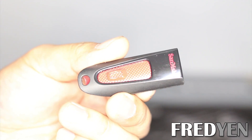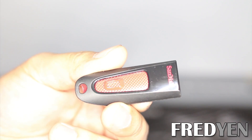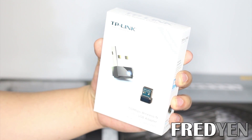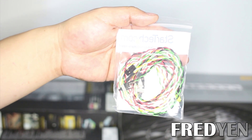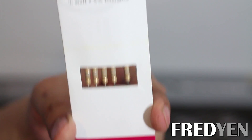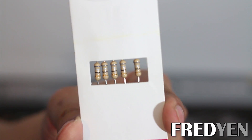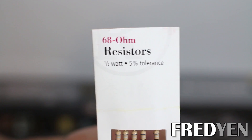Depending on what operating system you choose — whether you go with Windows or Linux — you'll need some type of hard drive. With Windows, you'll probably want to find the cheapest hard drive you can. But if you go with Linux, you can actually load the entire OS onto a thumb drive; you'll need at least 8GB if you go that route. You'll also need some way to connect to the internet — you can use a USB adapter or just use ethernet connected directly to your modem. The motherboard I chose does not come with a power switch, so it may be a good idea to pick one up. Finally, you want to get some 68 ohm resistors to make dummy plugs for your GPUs — you'll need 3 resistors for every GPU that you use that will not have a monitor hooked up.